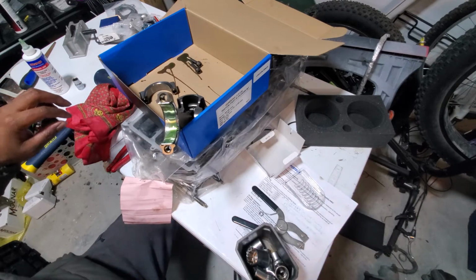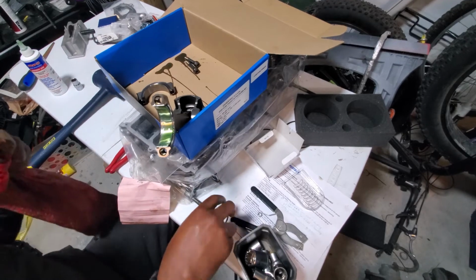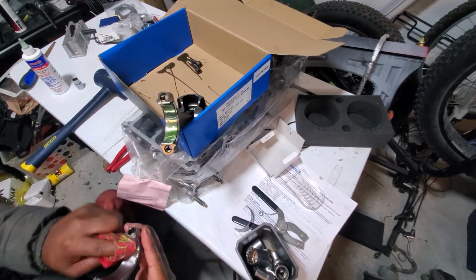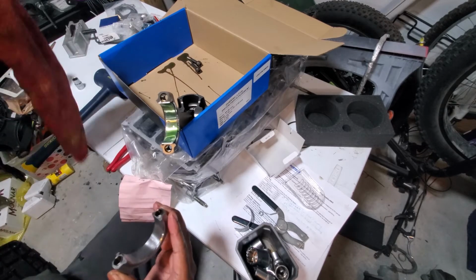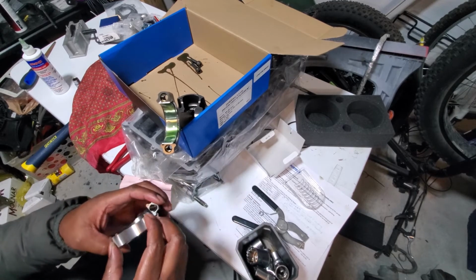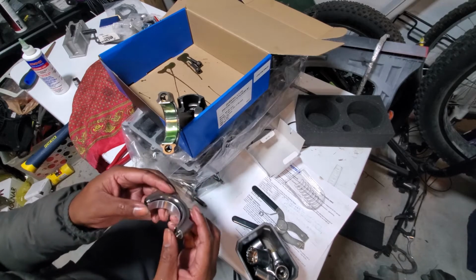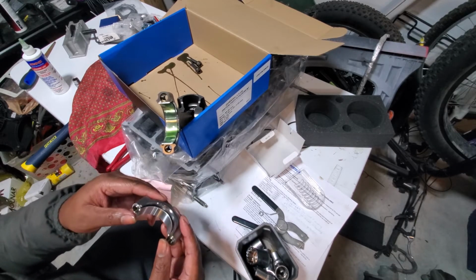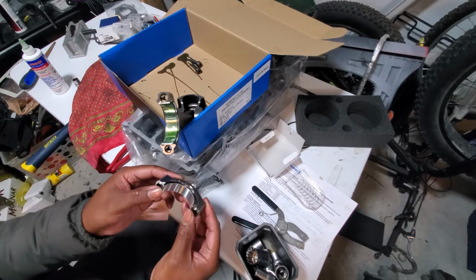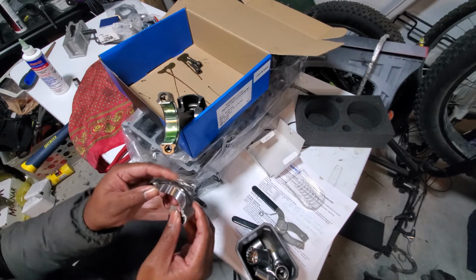So if you've done this right, you shouldn't have any extra parts. They should all be gone, FYI. If you have extra, you didn't put something on, and you need to go back and find out which part didn't get put on, because that is a very, very bad day for you. And I almost did it. When I was putting on piston number 4, I forgot to put the rod bearings on, but I remembered when I was putting it in the cylinder. I was like, oh wait, I don't have bearings on these. Let me go back, put bearings on.